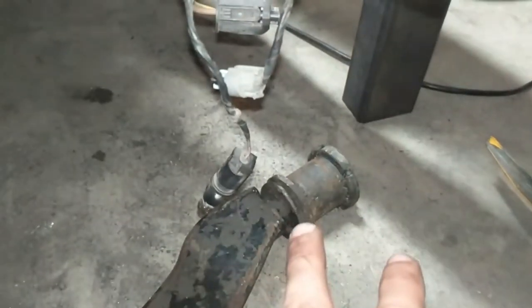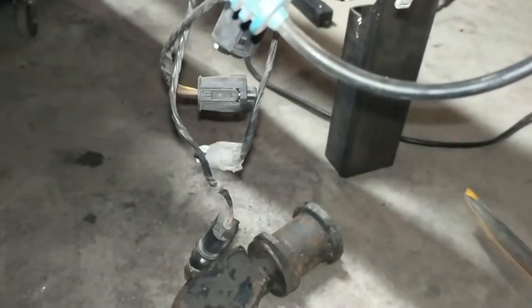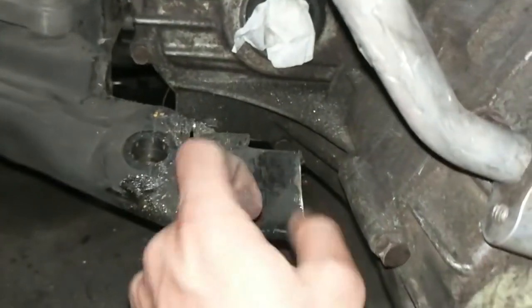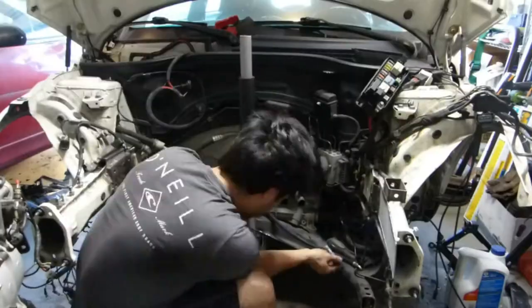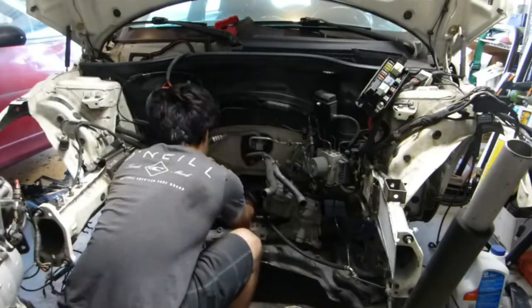We'll make a new collar for it, and that way if I ever need to replace them I can just replace them with OEM GSX - or obviously not going OEM because it's Initial DIY Mods - we're going to replace it with polyurethane. This one's polyurethane 60A; we might stick with 60 or increase it, just depends on how this works out on the chassis. Once the lower control arm is mounted in here, we'll remove the whole thing, finish cutting, weld up a plate, weld up some bracketry, put our bolt through, have the axle come through, and everything's going to be nice and happy.